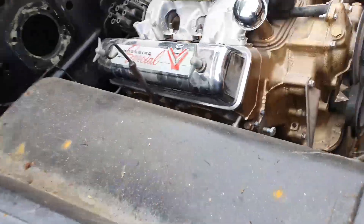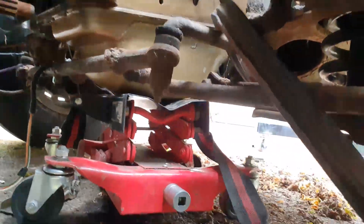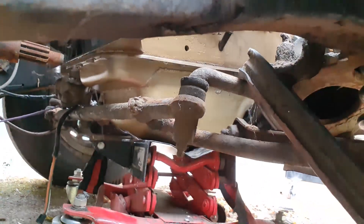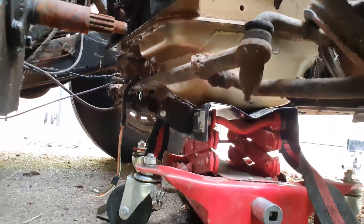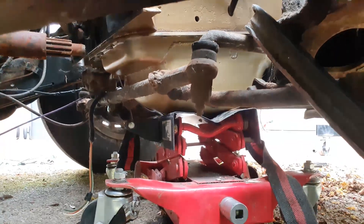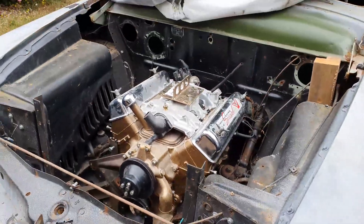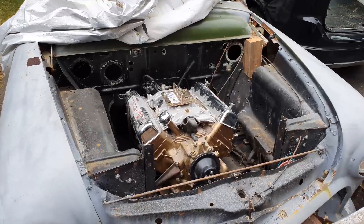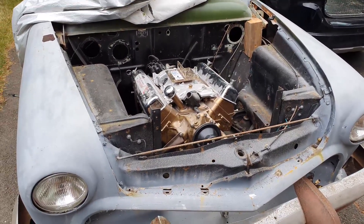We've got the modified truck dipstick and a lot of space down there. Dropping underneath the car, you can see with the modified rear pan sump that we've got clearance for the steering, and it sits on the crossmember nicely. Even with the engine sitting so low it's just about clearance for the oil pump — and obviously the engine's going to go up by about an inch when the mounts are finalised, buying us more space. Although it's a little bit dusty from the garage it came in, if I do say so myself, that is looking pretty sick. If you want to see more work on this as time goes on, please give us a like, follow, and subscribe.